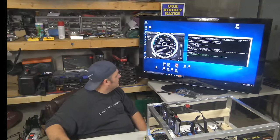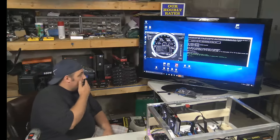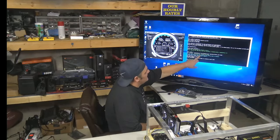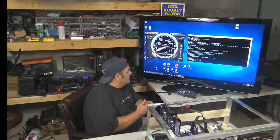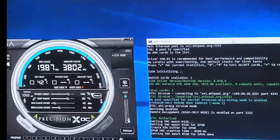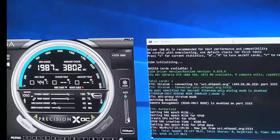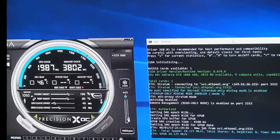Again, if you were here earlier, you've seen this. I'm sorry you're seeing it again. We got a lot more people on, and I want to make sure they can see this. Again, GTX 1060 3-gig, default clocks out of the box. This is equivalent to what you'd get if you bought this and just put it into an Ethereum rig running Claymore 9.3. Using the latest NVIDIA drivers, the drivers that were just out. So 19.1 with no overclocks out of the box, 19.1 on Ethereum.